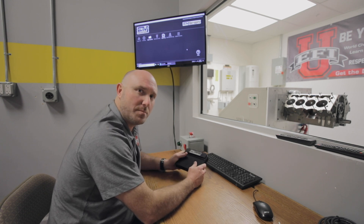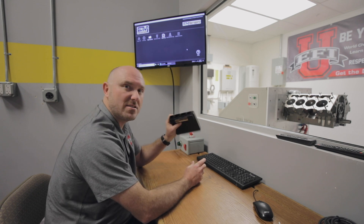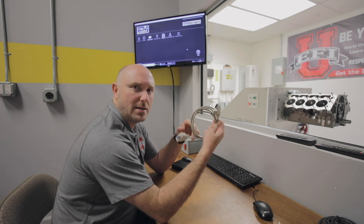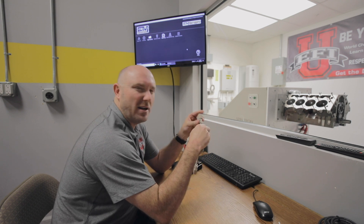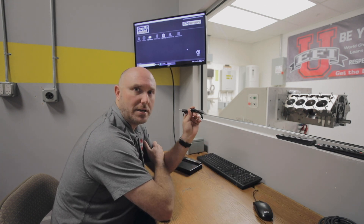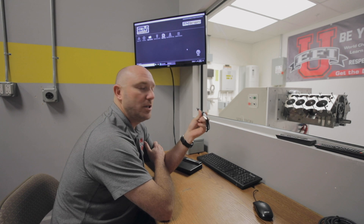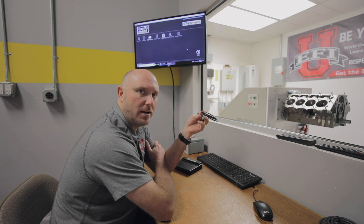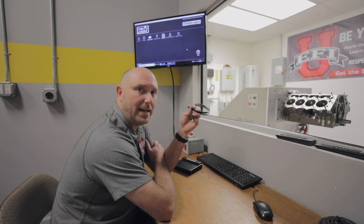The reason that's different is most older ECUs that aren't as fast and don't transmit as much data — the really old stuff — used a DB9 serial cable. But after a while, it got hard to find a laptop that used that, so most ECU manufacturers have now all changed over to USB. There's USB, USB 2.0, now even 3.0, but none of those systems are really fast enough to transmit all of the data capable in an Emtron ECU.